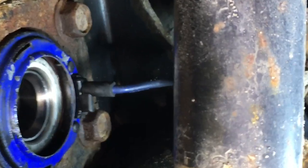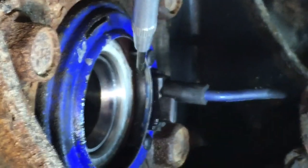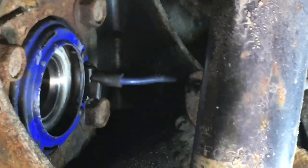Can you see the sensor itself? There's the sensor. I've already cleaned inside here — it was full of rubbish, all the rust, grit, dirt, road grime. For any SX4 owners, this is going to be worth mentioning again. Just get your WD-40. Clean it out, get your airline, crank up the pressure and blast it out — get it as clean as you possibly can. It's the back side of the wheel bearing, the wheel hub. Only applicable to all-wheel drive models. The two-wheel drive model hub assembly is completely different — there's no shaft, and there's an epoxy seal that goes over this, so there is no issue with contamination.